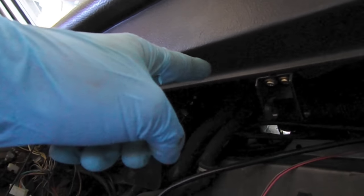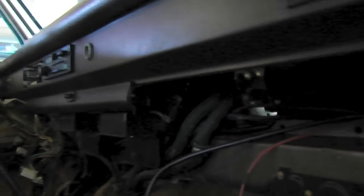We're going to go ahead and put this back into the van. The heater box is back in place. I was only able to get five out of the six mounting points — two on the front, two on that side, and one on the lower side. The bolt on the top was so rusted that the nut welded in there captured the bolt and just snapped it off. I didn't feel like messing with an easy-out since we have five out of six mounting locations — it's solid, we're good.